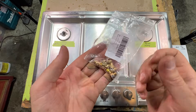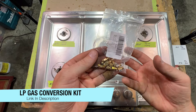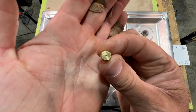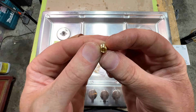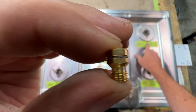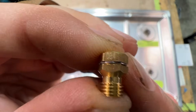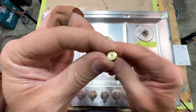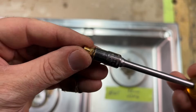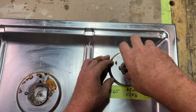This is what I ordered on Amazon — it's very cheap, only 14 bucks. They send you a variety pack of orifices, so you get something close to what you need and swap it out. This one here says 0.84, so that's just under the 0.88 we need for the back burner. I'm just going to open this up a little bit with a number 65 drill bit. What you want is a 7mm socket on a little handle — the 7mm fits right on the orifice and we're going to unscrew it.